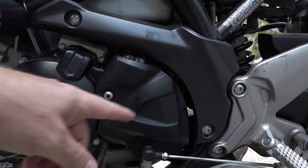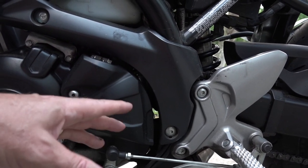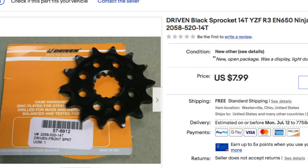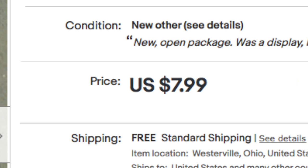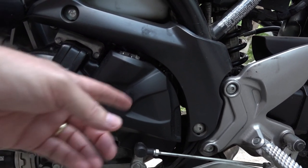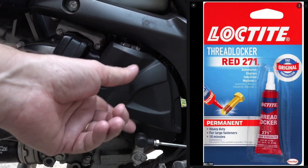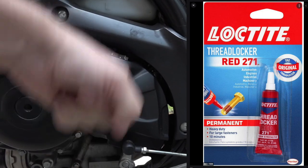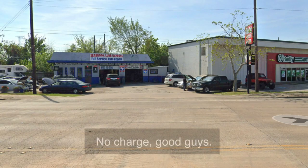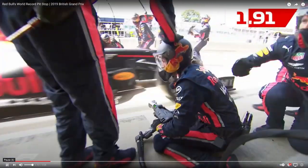The hardest part of this repair was actually changing the engine sprocket. I wanted a 14-tooth sprocket — the original Suzuki is a 15-tooth. A 14-tooth gives better acceleration out of turns on track days but a lower top speed, so I just wanted to change the gearing. The problem is the engine sprocket is literally glued on at the factory with red Loctite, and I couldn't move it with a big bar and socket. Eventually I took it to the car repair place and they got it off with an air gun in about 10 seconds.